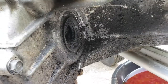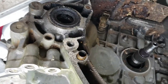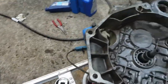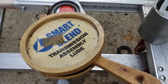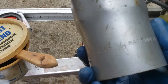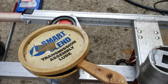That one, that one, and there's one behind the converter that I'll pull off. There's also a converter seal. We're going to get everything cleaned off, blown out, and sprayed off with brake cleaner. We got the transmission cleaned off as much as I'm going to clean it. Going to go ahead and put the torque converter seal in — got a little bit of trans gel or assembly lube. You don't want to send it in super dry, you want to wet it up a little bit. I'm using a two and three-eighths socket that fits pretty good on there — that's the proper way to do it. You need something that fits around that seal.